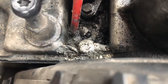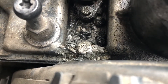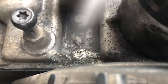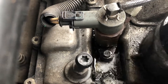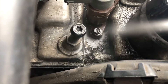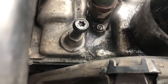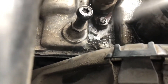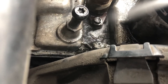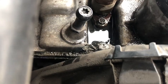I built a little tiny dam out of some blue tack just to hold the carburettor cleaner in place while I left it to soak. We'll squirt a little in there and come back to it tomorrow — trying to squirt it slowly so I waste less. I want to fill that void up and get a good head of it really, so I can see if it's gone down or not. I'll discuss a few things to try in case you need these techniques. We've got a good head of the fluid there.